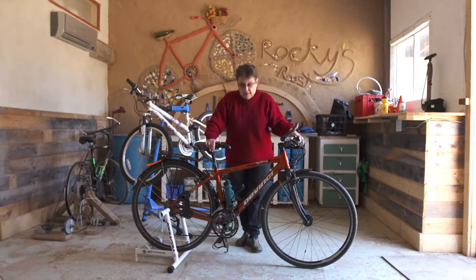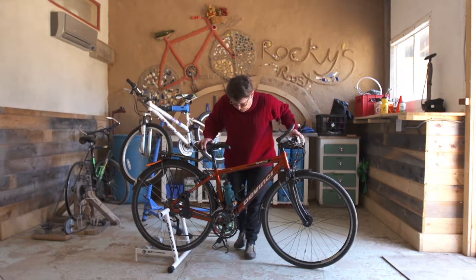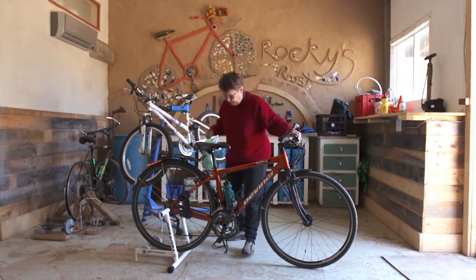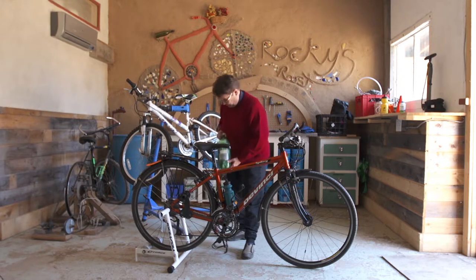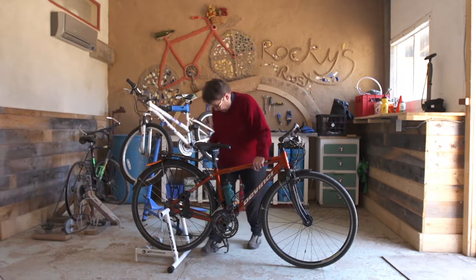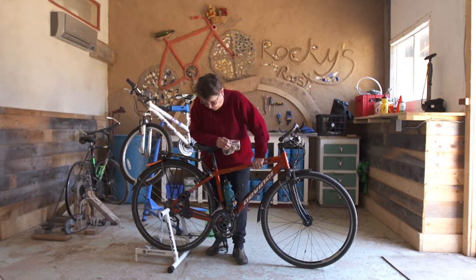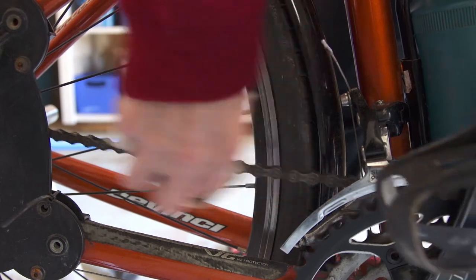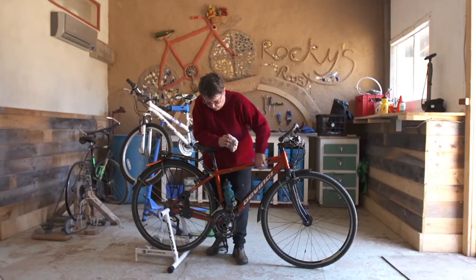This is the engine of your bike, so you want to keep it in really good shape. You want to clean it fairly often, and the easiest way is with a degreaser. You can get some nice ecologically friendly degreasers now, so spilling it on the grass or in your garage doesn't really matter. You can either spray it onto your chain and clean it off with a rag, or take your chain off and soak it. The easiest thing is to put it in a spray bottle and spray your chain.